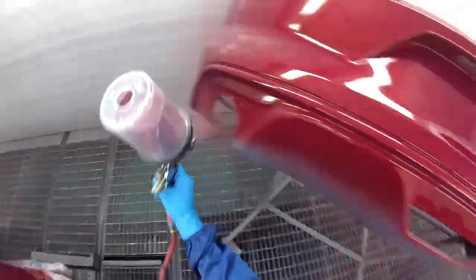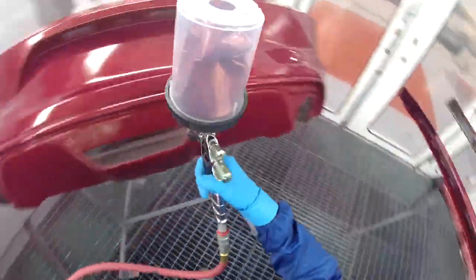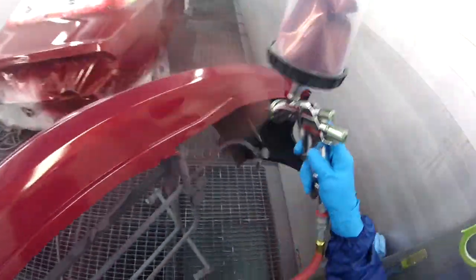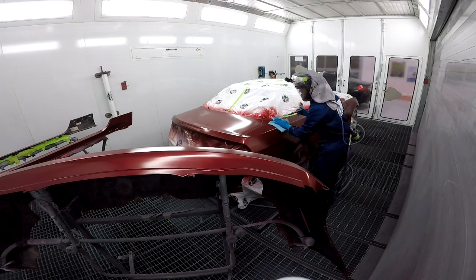So like I was saying, it takes maybe an extra 3 minutes to mix the right color and spray on top of that primer, right? Even if, say you have a spot with SG06, and you mix up a little bit of SG06 base coat and you spray it over, the edge that you sprayed over that primer spot is gonna be much easier to cover than an actual primer edge that has been sanded. So that is very important.